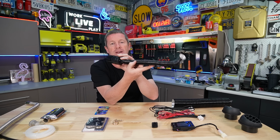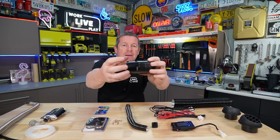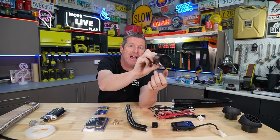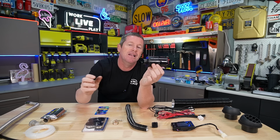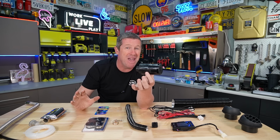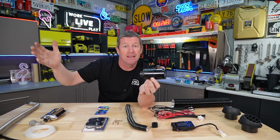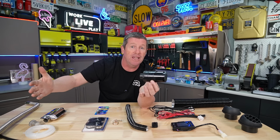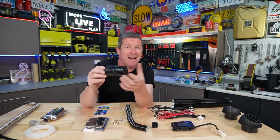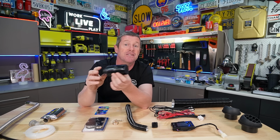If you face it forward and you're going through a lot of mud and stuff like that, you can get a lot of dirt build up around here. So to alleviate that, I'm going to try to have it towards the back, maybe around behind the chassis rail, just to try to keep as much dust and mud out of this as I possibly can. Because it's mounted on the back, you will have some coming up, as opposed to if you mid-mount it, basically between, say, the tow vehicle and the front axle, you won't have so much dirt and mud being flicked up, depending on where you're going, obviously, but that's just another best practice sort of thing to do.